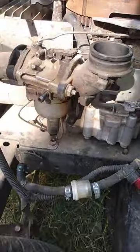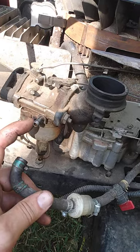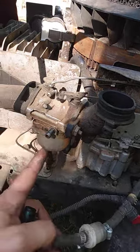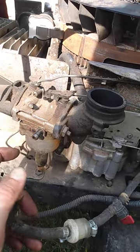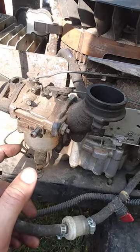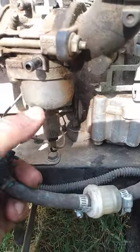Quick recap: the fuel line was flowing good, but this right here — I blew through it and it was plugged up, so we weren't getting gas. Cleaned out this part — two Phillips screws, one on the side — gasket, a couple small fragile pieces. Just gently pull it down or let gravity take it. There's a springy part on the bottom inside, and then you get it all open.